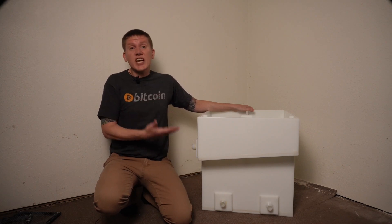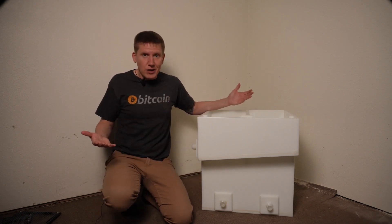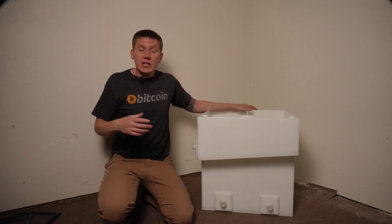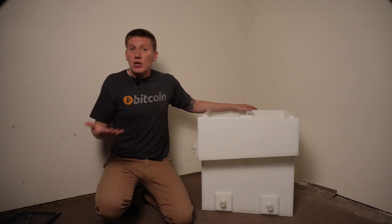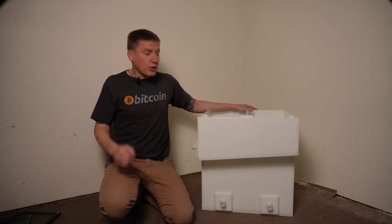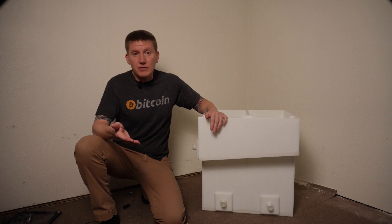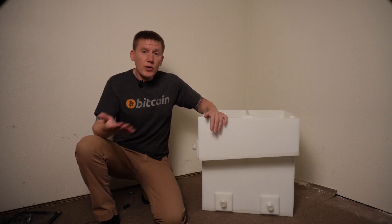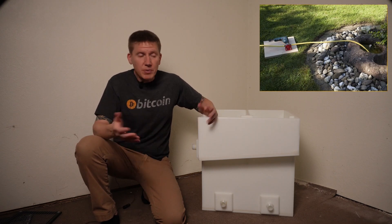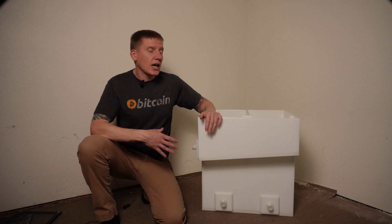With the tank built, the next thing to do was check it for leaks before installing it in the rest of the system — so that if you have to send it back to fix a leak, you're not tearing apart everything else. I plugged up all the ports with caps and filled it full of Bitcool. You generally want to use Bitcool and not water because Bitcool will find leaks that water won't. I left it for about a week, giving the fluid plenty of time to find any openings. Lucky for me, no leaks — so I took off the plugs, drained the fluid, and I'm ready to go. On a side note, I had to load five different buckets of fluid in and out of this tank, which was a real pain. What really helped was a drill pump — a simple plastic pump powered by a drill, really cheap and made for temporary jobs like this. I have a link below. It's super handy; I highly recommend it.